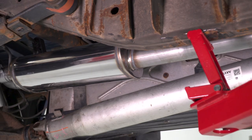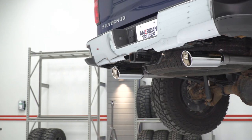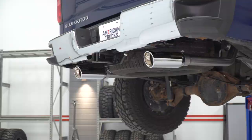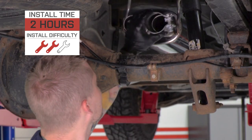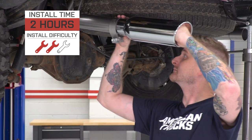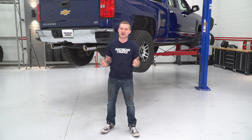There are a few other reasons to like the MF Series cat-back, and one of those is quality. This is just under the $1,000 mark, pretty middle of the road for higher-end systems. It's made out of 409 factory-grade stainless steel so it will easily last the life of your truck — a nice touch if you live on the east or west coast with bad weather. It installs very easily with no cutting required, reuses all your factory hangers and rubber isolators, so getting it hung in the driveway with basic hand tools should only take about an hour or two. For that reason, this install gets an easy two out of three wrenches on the difficulty meter.